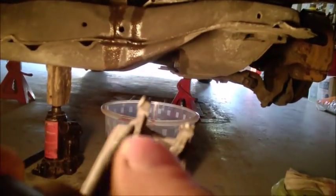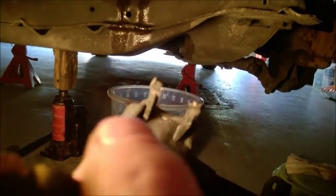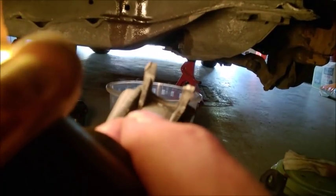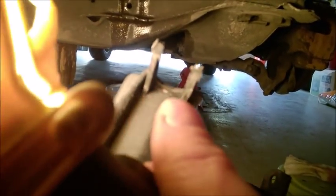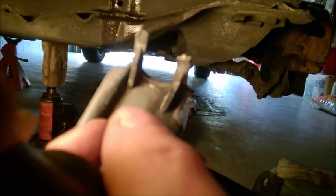So basically you apply a coat, really just a small film, and you place the cover in place. You tighten all the bolts finger tight, just with your fingers, and then leave it like that for 1 hour. Then come back and tighten to the final torque, which is not big. Just go with your guess actually. Don't crush it too much, because you will crush the sealant and it's not going to seal.